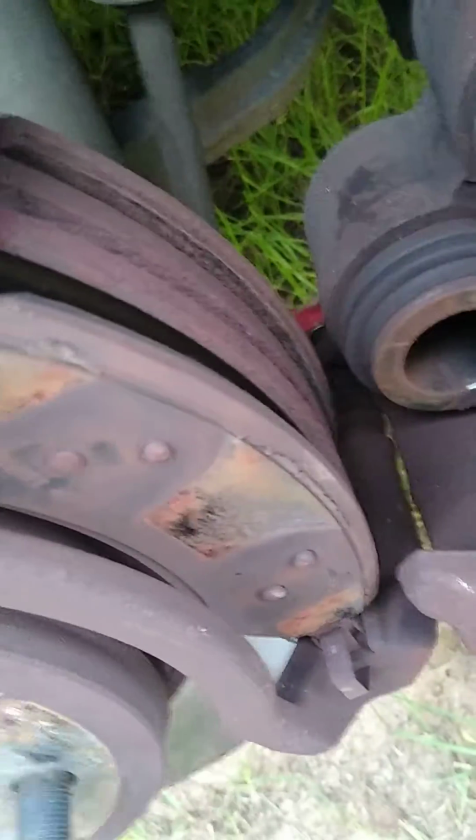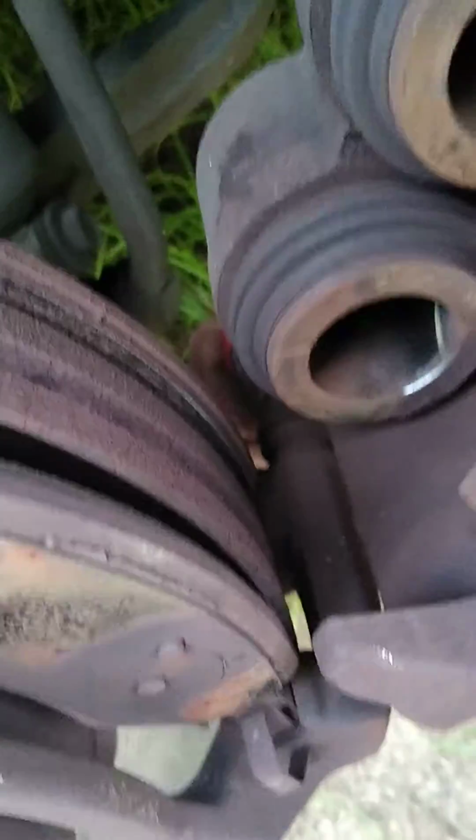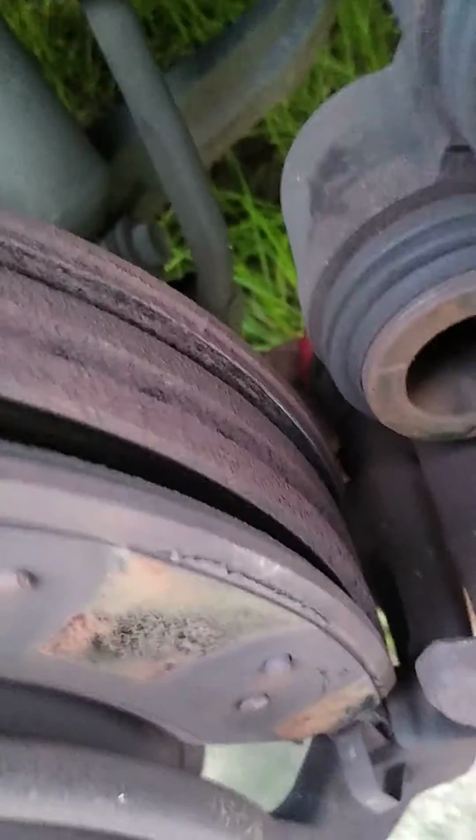Now what I did was I just put the ratchet wrench on, in my case, right here on the back caliper bolt until I could get this freed up. And the reason why is because this is actually designed to pivot. If you see here, it comes. Let me pull the pad out of the way, it'd be easier to show you. But yeah.